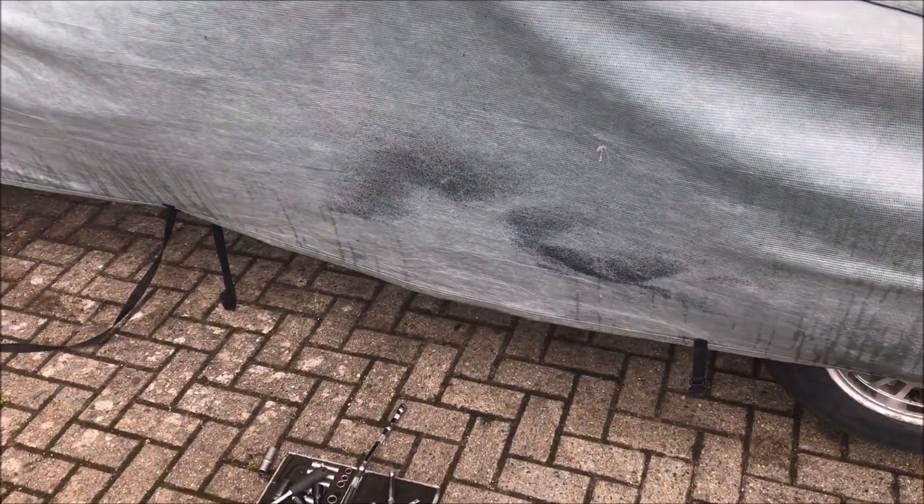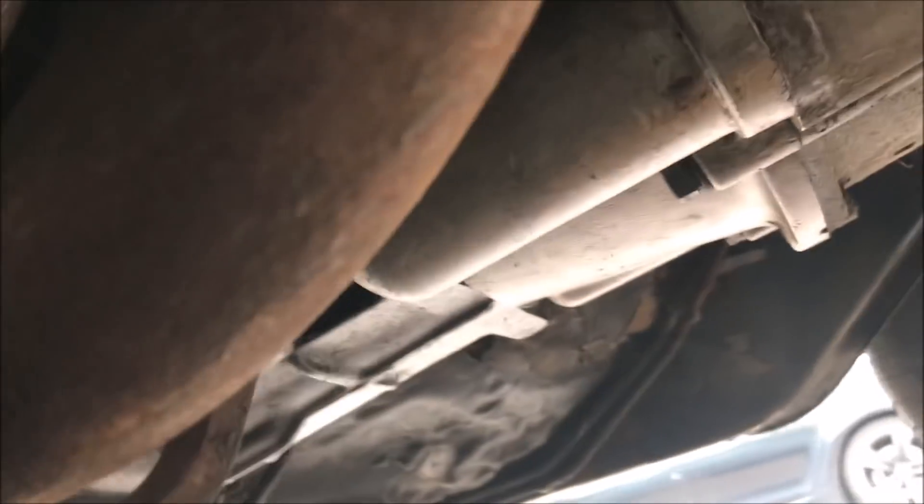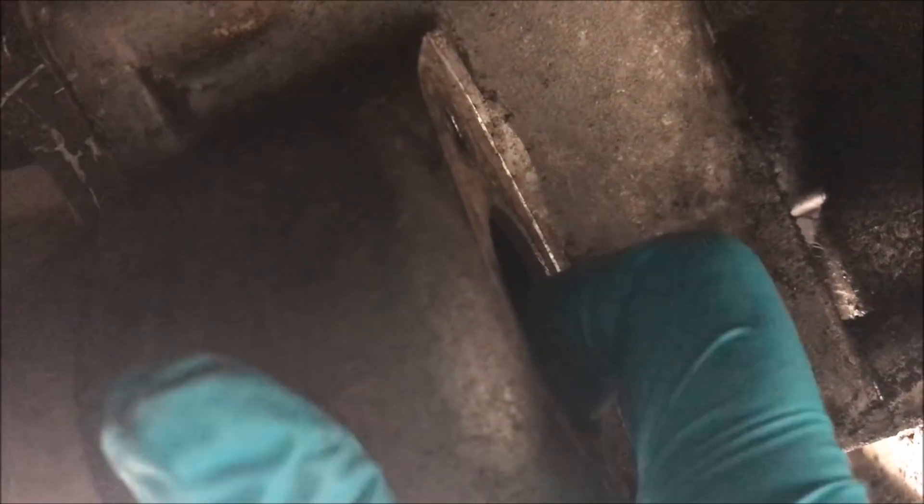Nothing is simple — we have a problem. Basically, the rod that goes from the clutch fork and should be coming out through this hole to engage with the slave cylinder has got stuck. I didn't realize when I bolted the gearbox on, so it's now butted up against the inside of here and I can't get to it at the moment. I'm going to have to either get some sort of bent screwdriver and flick it out...